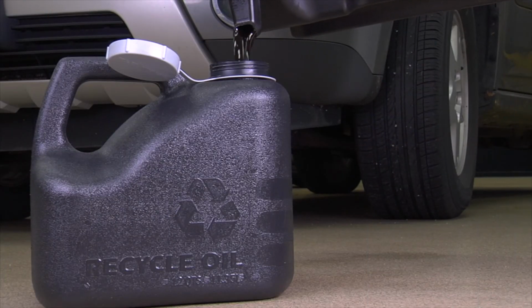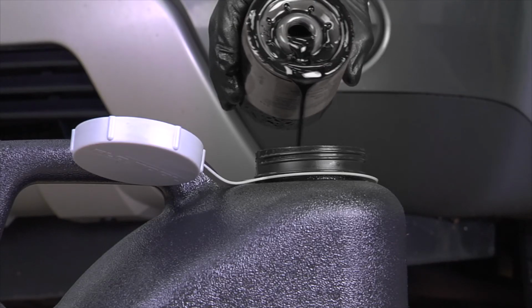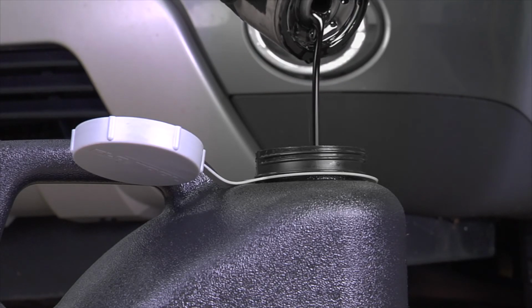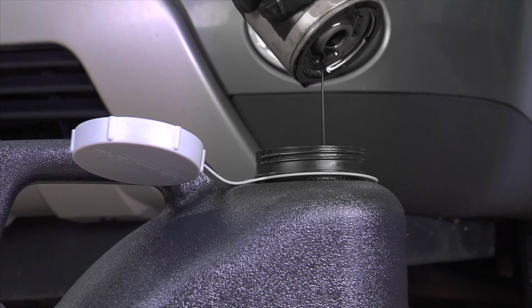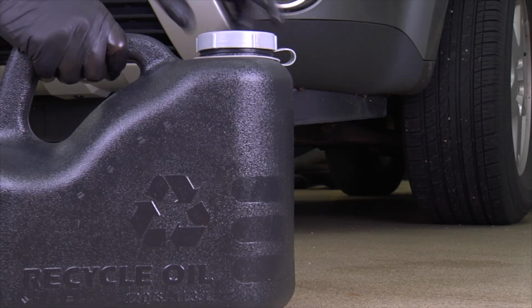When the old oil is cool, pour oil into an approved disposal container with a screw-on top cap. You may consider using the empty oil container from the oil you just poured into the vehicle. Also, allow the excess oil to drain from the old oil filter to ensure it is empty and clear of oil. Many auto parts stores and service stations will accept old oil and oil filters for recycling.